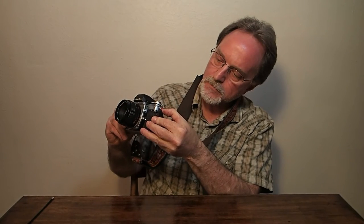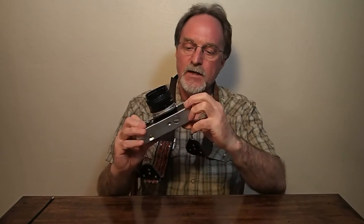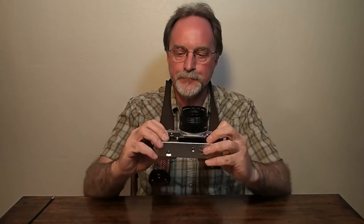The battery check is on the left side. Turn it on — see if those batteries are any good. You get a red LED when it goes down, so they're good batteries. On the left front, this is the lens release button — counterclockwise to release. Pretty much everybody but Nikon does that. It also has an X-Sync or PC-Sync connector, but it only syncs for electronic flash at 1/90th. And like most of these older Minoltas, when this button is out, you're doing stop-down metering if you're using bellows, an extension, or an old lens. It's coupled when it's in for aperture priority auto exposure.